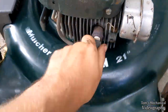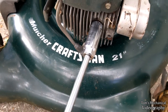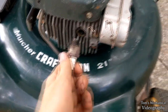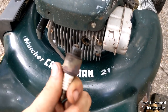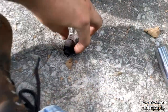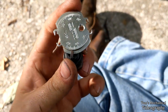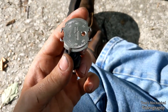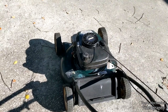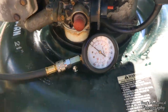Spark plug is off because I want to see how horrible it actually is — I may have a replacement. That came out with no effort at all. Spec is 30 thou and this is reading 27, so we'll give it just a little tweak and clean it up a bit, then stick it back in. We're actually under gap and it runs. Compression test says 85, so it's not the healthiest engine, but it runs.